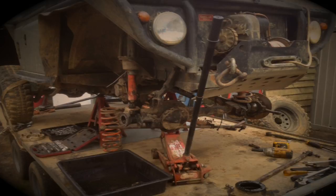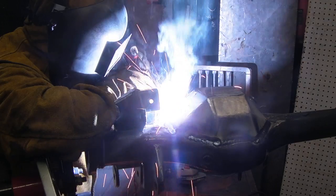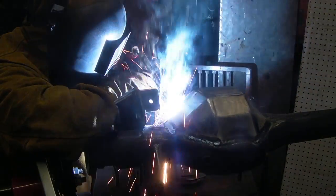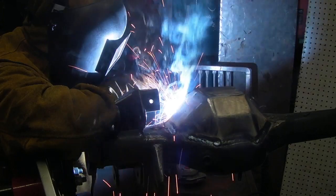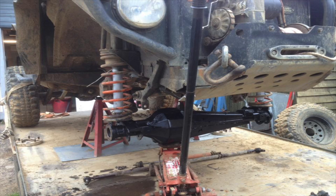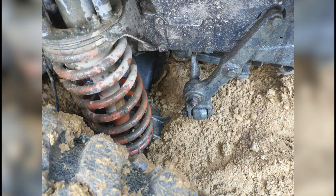Hans has been fairly busy recently, and one of these has been getting his off-roader back up to spec because it's falling to bits. A little while ago, we actually welded up an axle with a diff pan and some trusses to strengthen it up — the front axle casing. Well, the whole axle's been rebuilt now. You can see the sort of abuse that it will get on his off-roader, so it's a welcome modification for him.